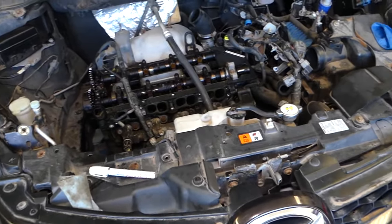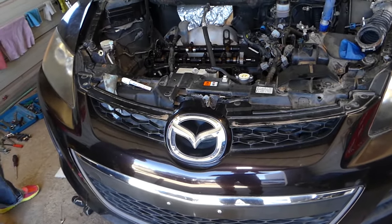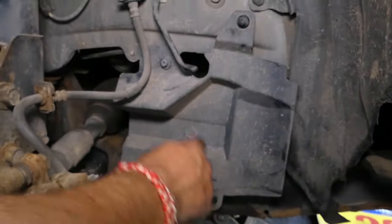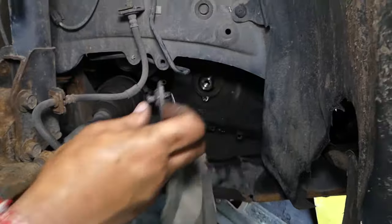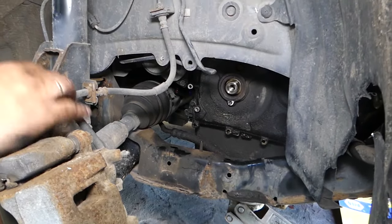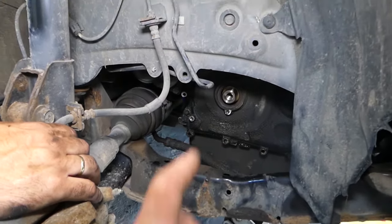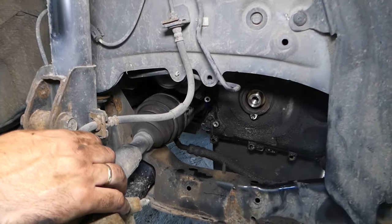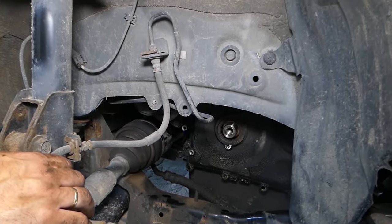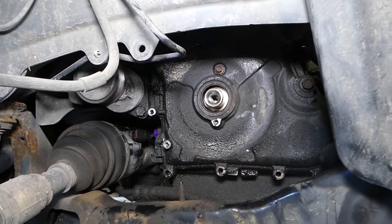All the tools and parts we use in the video will be shared in the description below. We're starting on the right side - the right wheel is removed. Once you remove the right wheel, you have a cover with four clips to remove. After that you get to the crankshaft pulley and the crankshaft position sensor. We'll also need to remove the serpentine belt. This is not a keyed pulley, so we need to bring the engine to top dead center or the timing will be off and the car will not start.